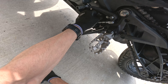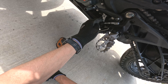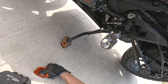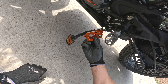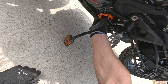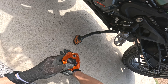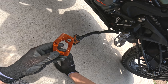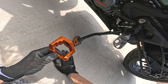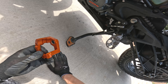Some bikes will have a very wobbly shift shaft. I haven't removed any of this stuff, so I don't know the true free play, but just from wiggling it, there's probably about one millimeter of free play in there. This part is installed just behind that shift arm right there, which should ideally translate into a smoother shifting experience. Now I don't think this is going to do much, as is the case with most AliExpress parts — but I saw somebody online put this on and it sparked my curiosity. I want to see if it does anything.